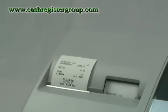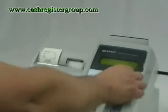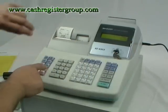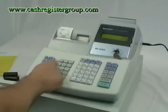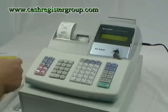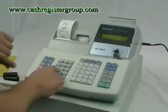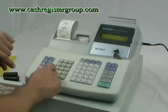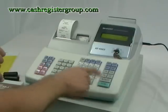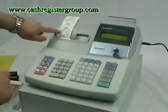I need to set the time and date now. Turn the key to program. Enter the time in military mode — it's 10 to 5 so it will be 16.50, press it, then press the TM button. Then enter the date which will be 26.08 for August 2010, press TM ST. That's printed up also.